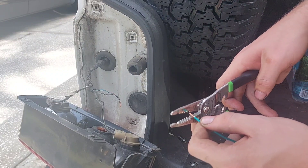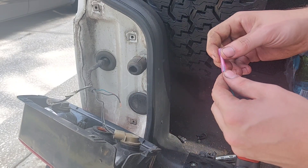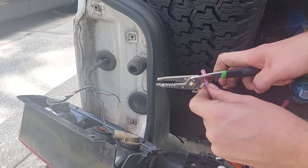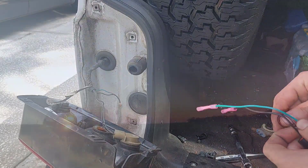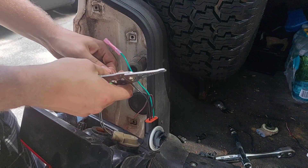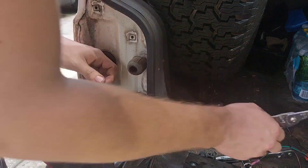What made me no longer have an NP242 was not its behavior with a manual — it was its practicality in general. I found that having all-wheel drive without ABS or traction control really isn't all that great. I was directly comparing it to a 2002 Subaru Outback, which handles all-wheel drive very professionally and always knows what to do with itself. Where the XJ, being much more primitive in comparison, didn't really know how to drive in all-wheel drive mode.